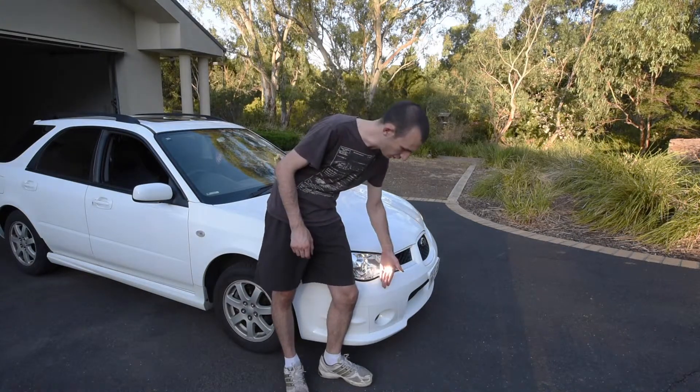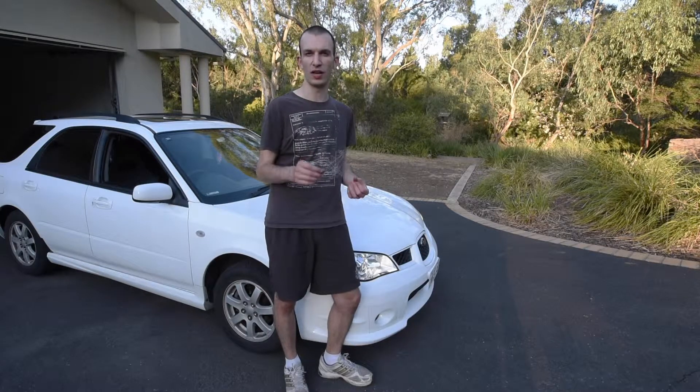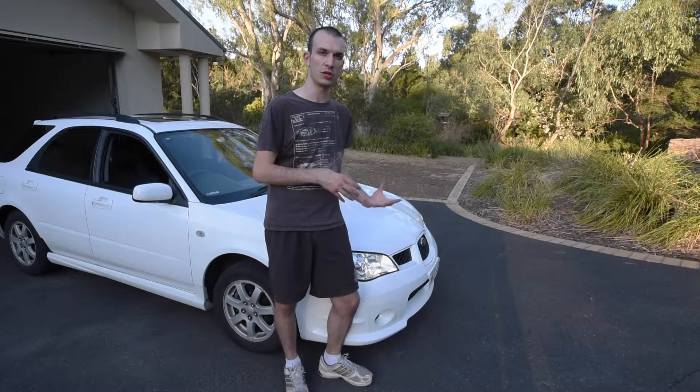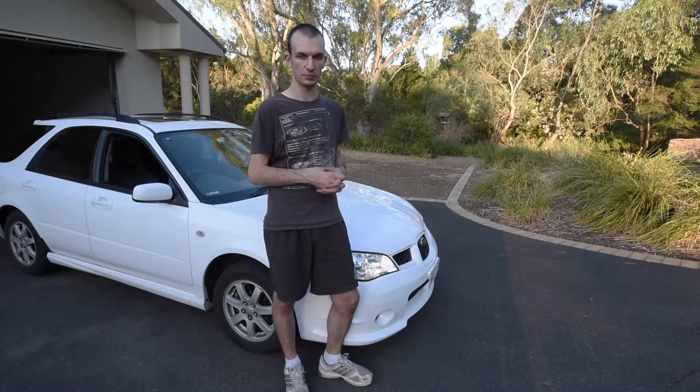So there we have it — a H7 5000K HID kit installed on a 2007 Subaru Impreza. As you can see off the reflection on my hand, it's a nice white colour, which is exactly what we wanted for this customer. 4300K is a more yellow colour but it has more light output, and 6000K is more of a slight blue tinge but has less output in terms of lumens. So if you want nice and bright HIDs go for the 4300K option, but if you're more concerned about colour we want it nice and white, so we've gone for 5000K. In these lights the OEM is a 55 watt halogen globe, and we've only needed to use 35 watt HIDs to already quadruple the light output.